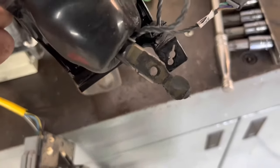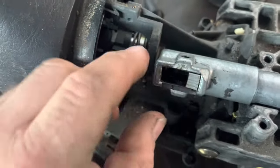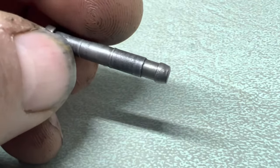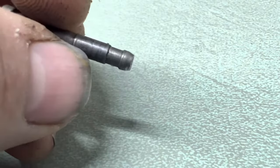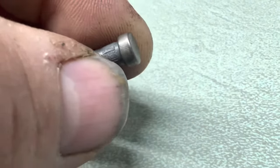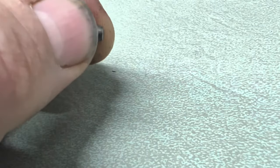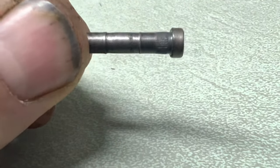That hole right there has a pin that goes down through here and holds it in. Here's the pin I'm referring to — you can see this line right here, how it's necked down from here to here. It shouldn't be like that; it should be smooth all the way down. This part goes through the bottom, it's got a little lock that you put on it, and this knurl here drives into the top. I think somebody actually put that little lock on the end of it because it wouldn't hold anymore — it's worn out completely. That translated into a lot of slack.